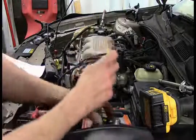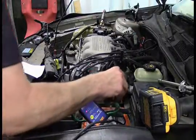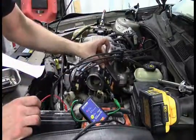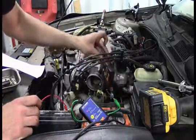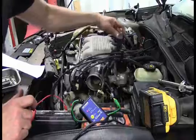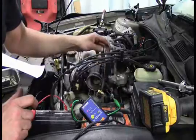So what I'm going to do is connect this up to our signal wire. What we're going to do is go ahead and follow along. Oh, it can't be that easy. There's no way. Unbelievable. So it looks like there is an open right here. Oh, if that's the case, I'm just going to be thrilled. I told you this is a cool tool.